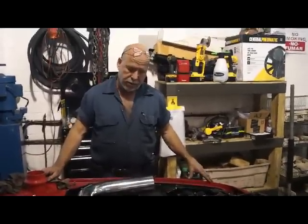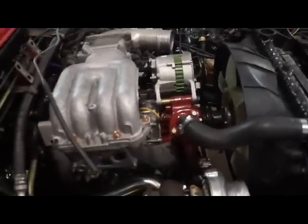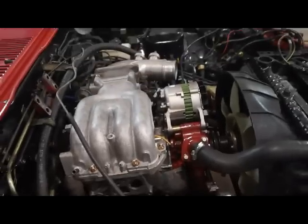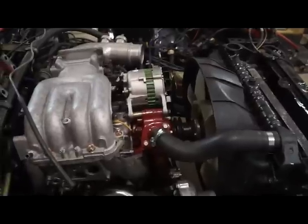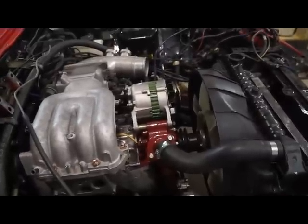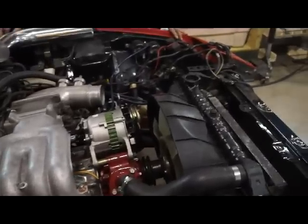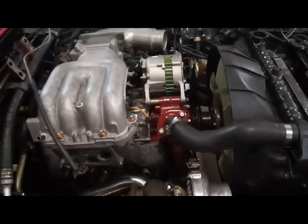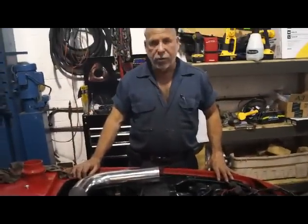This motor here, it's a nicely ported engine. It's got a bunch of good stuff. It's got 3 millimeter seals for durability. It's got '93 rotors, which I despise, but that's a different story. They still make good power. '93 intake, damn good size turbo, excellent intercooler. Where I'm getting at is that it's way too much motor for this.